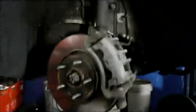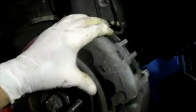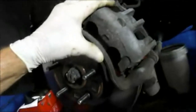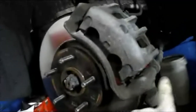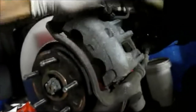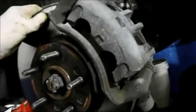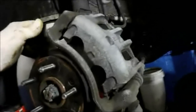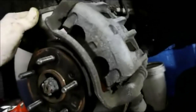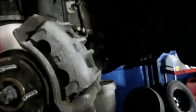In this video I'm going to show you how to replace the front brakes on a 2009 Hyundai Santa Fe. Fairly simple. What we're going to do first is disconnect this bolt right here, then take the caliper and flip it up. The customer does not want the rotors resurfaced, so we're just going to do a pad swap — put new pads on it. Then we're going to push the pistons back in.